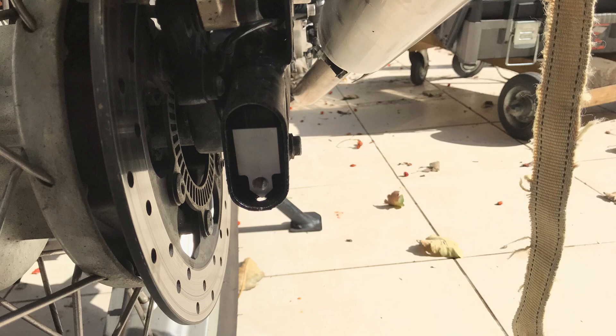You put the blocks in. Now you can see the holes I mentioned earlier - there's a hole in the swinging arm. That has nothing to do with the Stratus chain tensioner. Don't be misguided into thinking something sits in that hole - it doesn't. It's a drain hole. In my opinion, that is a hundred percent a drain hole for letting water out of the swinging arm. That XV250 - it rotted it from the inside out, and the same on my Pan European which I had to weld and get powder coated. So ignore those holes.